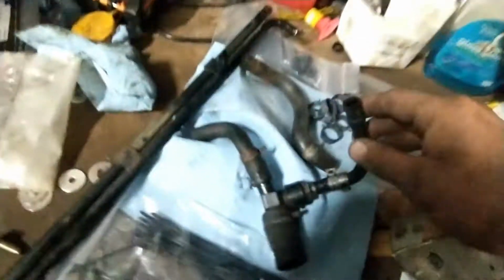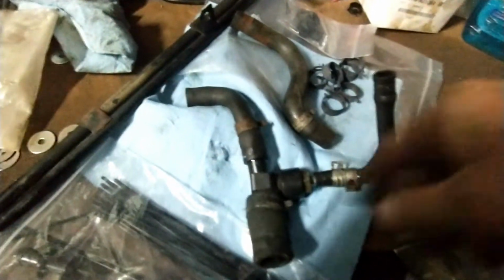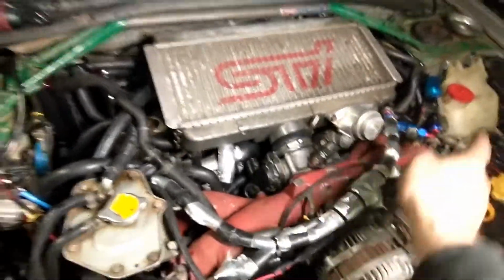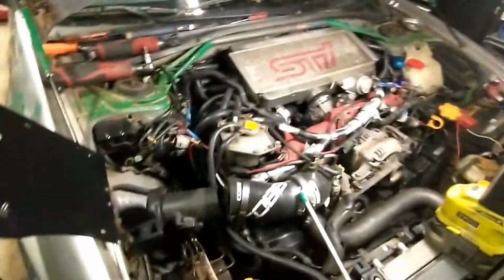If you reuse, like I did, the PCV hose from both sides to feed this and this guy here to the box, what you are going to be left with is the original T that you removed from the block with the two lines attached to it. That's the coolant hose that goes from the upper reservoir to the turbo, and a bunch of clamps. You won't need the hard lines at the front of the intercooler here, so you can remove those, because now everything is plumbed behind. There is the extra amount of hose. I got quite a bit of 1/2 inch. That's a chunk of 5/8 I cut, and that's about it.